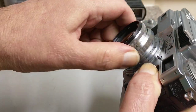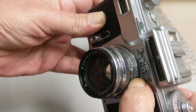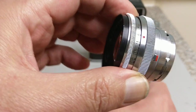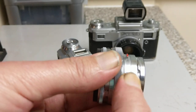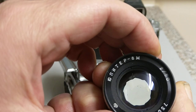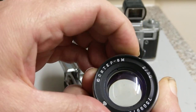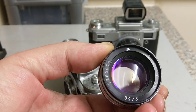You'll notice you can focus it using this method, which I do find easier. To remove the lens, you'll see there's a lever here — you simply depress it in and the lens will turn and remove. This is the 50mm lens — very small. This is an f2 lens. It does recess back into the body a long, long way. The advantage of rangefinders together with TLRs is that they don't need the automatic stop-down function, so the irises on these are a lot easier to manufacture. You can see the irises — obviously you're not looking through the lens, it's slightly offset. Metal, chunky, got a coating on it.